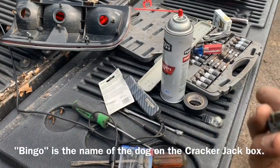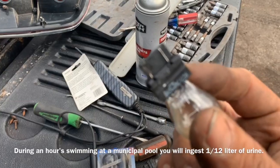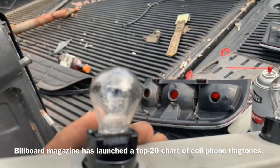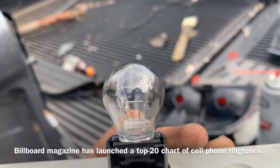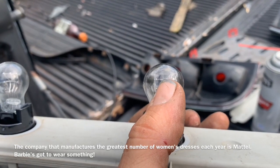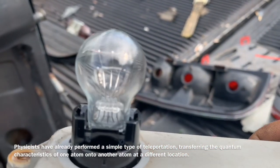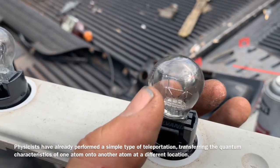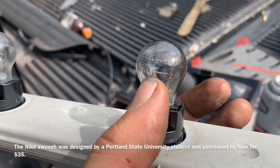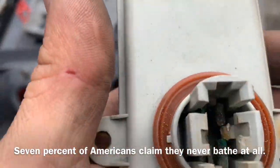We're going to remove our bulbs - we want to look at the bottoms of them, make sure they're not all rusty and looking bad. This one's melted right there. To check if your bulb is bad, these little wires should be connected to each post inside here. This one's gotten hot because the wire should be somewhat straight - it'll probably burn out soon but it should still work. This is a dual filament bulb, which means it has two lights in one - you can see it has two bands. A single filament bulb has one band. There are also tri-filament bulbs with three bands. This one is blown.